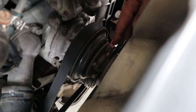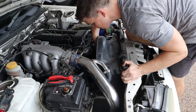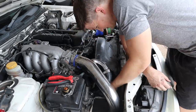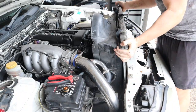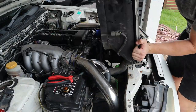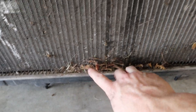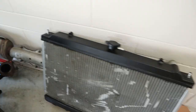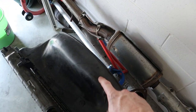Now we need to undo and disconnect the fan from the pulley. Here's the old radiator - nice little collection of leaves. This is why we're replacing it; you can see the end tanks are a light gray, not black. We're going to be fitting up the old shrouds. I did consider putting in thermo fans, but I think the factory shroud is actually really good for cooling - I hear of people having issues when they swap to thermo fans, though maybe we'll get some in the future.